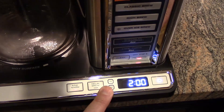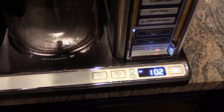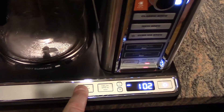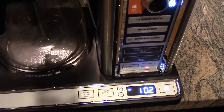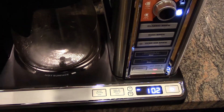I'll set it back to the default. But there you go — if you want to change the amount of time that your hot plate stays on, press and hold your stay warm button, then change the time with your hour and minute buttons. Hope this helps. Thanks.